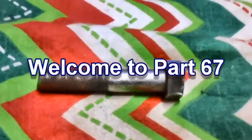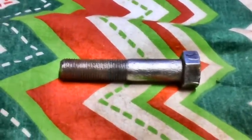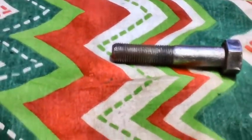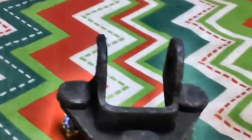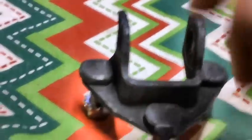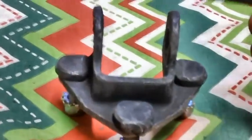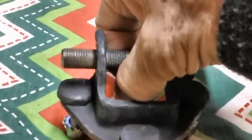As predicted and hoped, I did find out where our orphan bolt goes from the last Thunderbird video. It goes to the shock mount. The front shock goes down through the coil spring, and this here bolts to the upper control arm, as opposed to the lower control arm on most cars. Then this thing goes through like so, and the shock attaches to it.